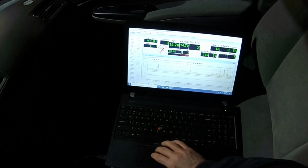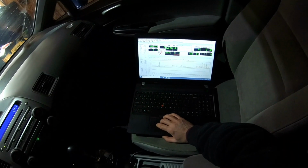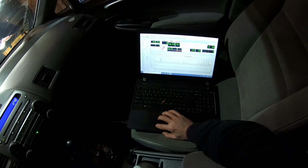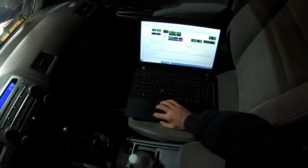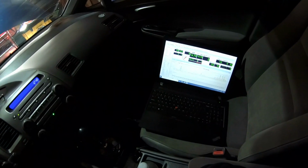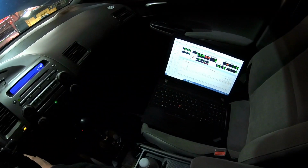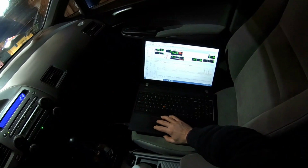God damn it. Okay, error code P1157, air fuel ratio sensor range performance problem. So basically, it's not reading your O2. I wonder why. It's still in open loop. It's not working, so it's just going to stay in open loop. And I'm probably running hella rich. I wonder why. I bought this so long ago, I can't even return it. How much was the sensor? Yeah, 30.